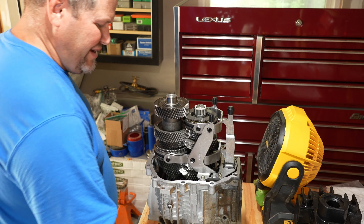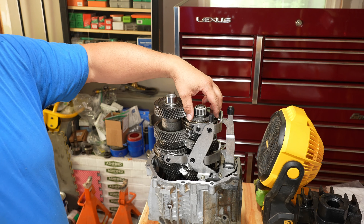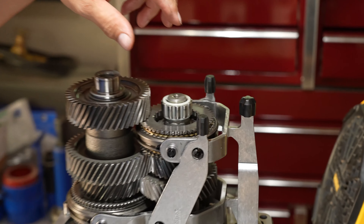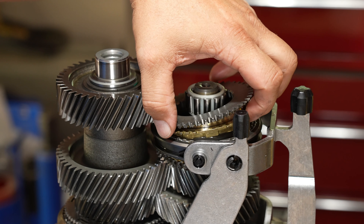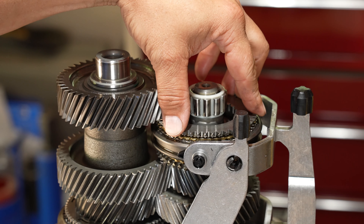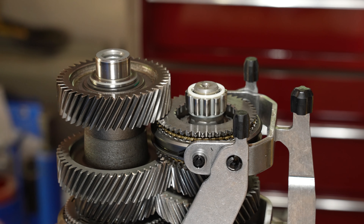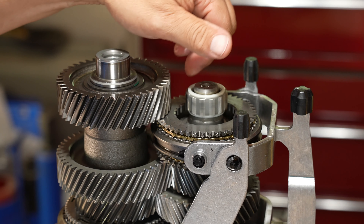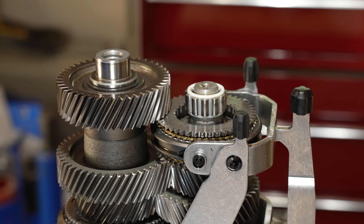Got word that Harley's heading back with the seal. This thing has dragged on too long — well, we're just anxious. I slipped this bearing on off camera. This synchronizer right here drops down in there — I guess this would be called a blocking ring. That's in there, I dropped my bearing down in there, oiled everything up, everything's looking excellent. We've got to be getting close to siliconing that base.